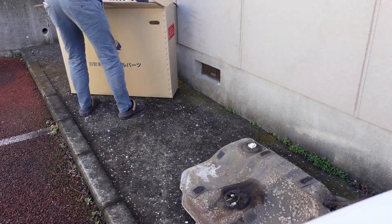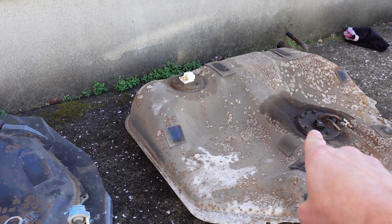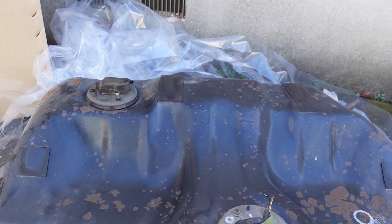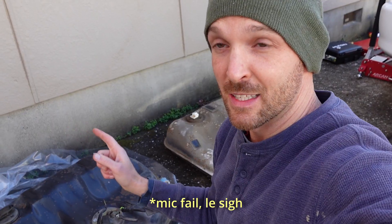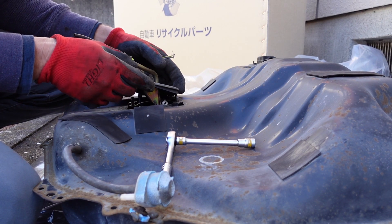With the old tank out, I've got to do a little comparison — old tank versus new tank — make sure we got what we need, it's gonna fit, and figure out our shopping list. First impressions: not too bad, went from that yuck to that. Be careful if you've got a DC2 or DC1 two-door — this is a two-door gas tank. The lid has your fuel pump lid and your sender for your fuel level. When looking on Yahoo I noticed there's two different versions: this is a three-bolt bolt-down style which is what mine has, and there's another style which is like permanently mounted. Don't assume every DC chassis Integra is the same. Let's open it up and check it out.